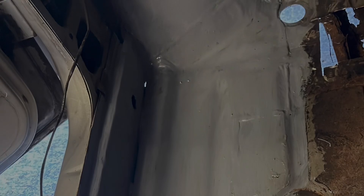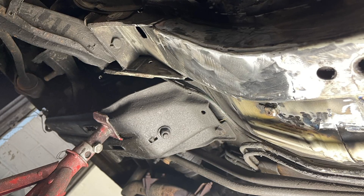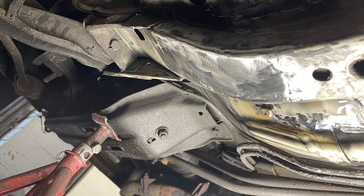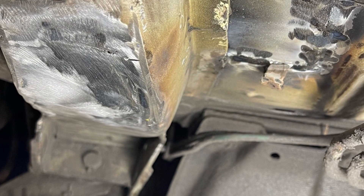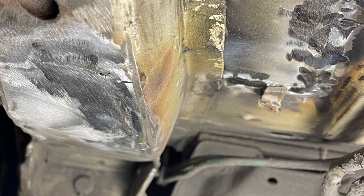The next section to do was the chassis. This had been repaired previously and very poorly. It's a double skin section, so once I cut all the outer skin off I had to cut all the inner skin off, weld it up, and then do the outside. I butt welded this up to make it look like factory and got the results I wanted. As you'll see later on, once it's stone chipped it covers really well and doesn't look like it's ever been touched.